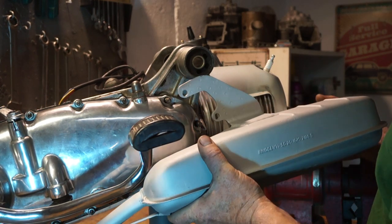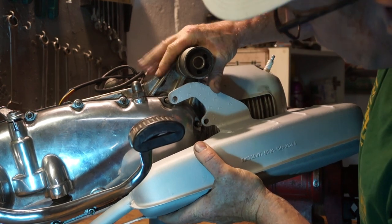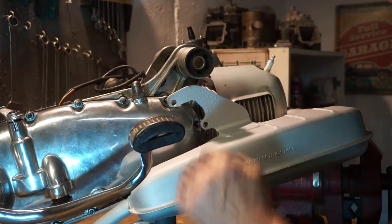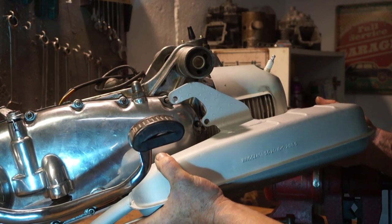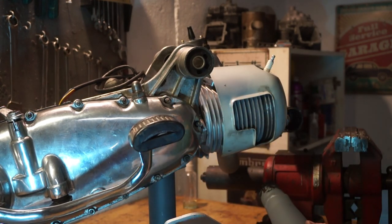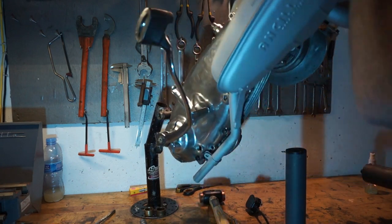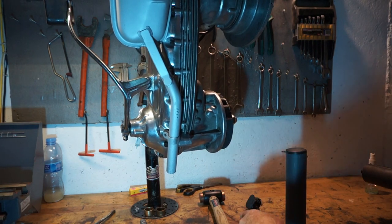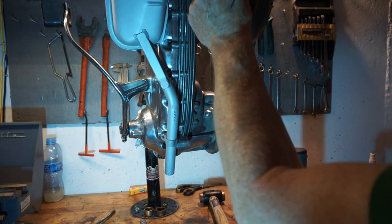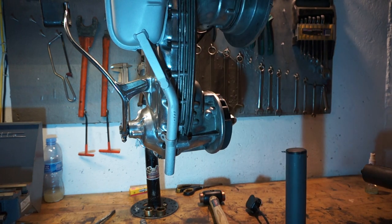So we fit the exhaust on. Your exhaust should fit easily without any stress on the bolts. As you can see, this one — because we've got a packing plate on the barrel — doesn't line up anymore. So we need to elongate the bolt holes a little bit to avoid too much stress. As we can see it just doesn't quite line up; there's just an edge there that needs taking out. I don't want to force the brackets, so I'm going to get in there with the Dremel and just take that edge off so our bolt goes in without any problem.